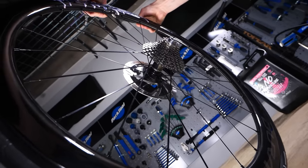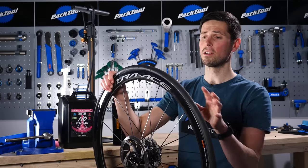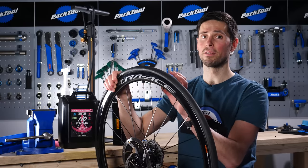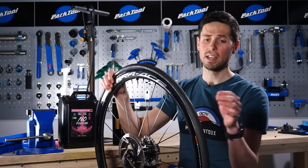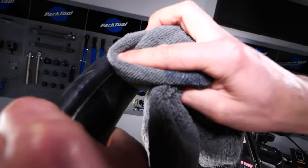If you're finding it tricky to get this last section of tire on, there are a couple of little tips you can use. Make sure the final section of tire you're fitting is near where the valve is — that'll make the tire a little bit slacker to put on. Also, make sure that the bead of the tire you're doing is pushed all the way into the center of the wheel well, because that'll free off more space too.